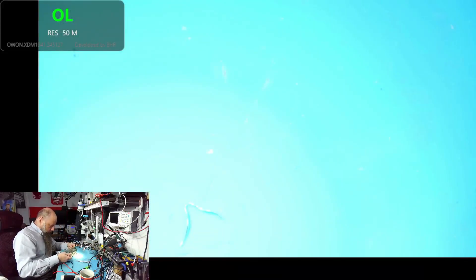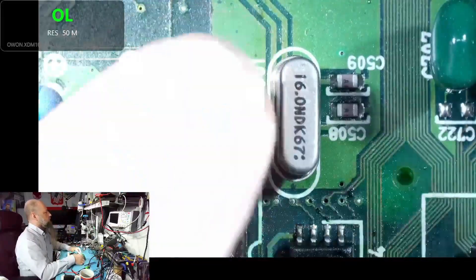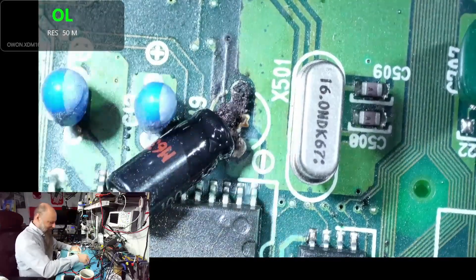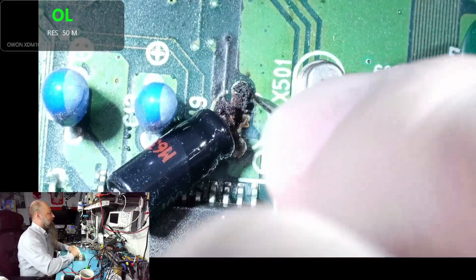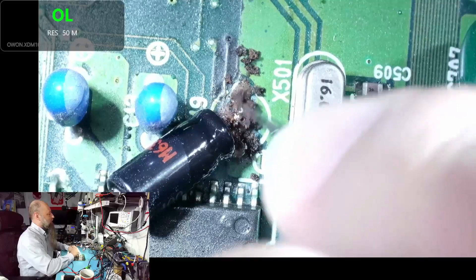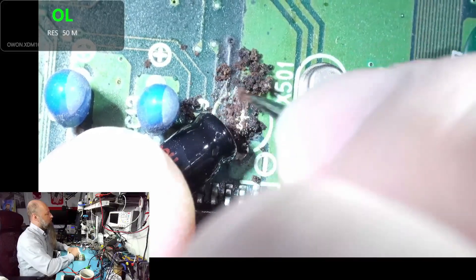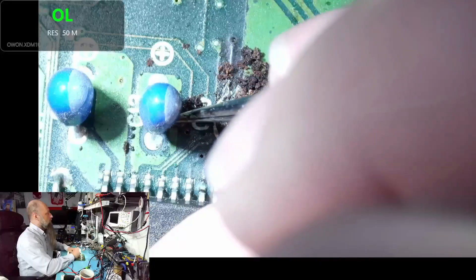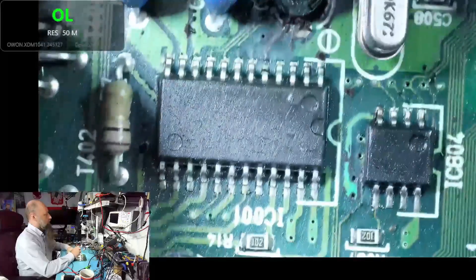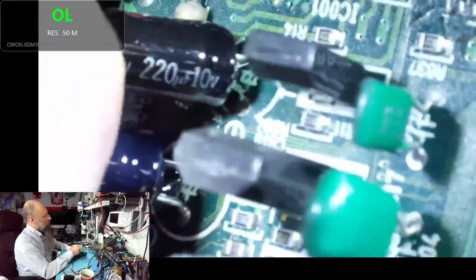There's likely no EPROM here — this is a 90s ECM, so no VIN lock, no immobilizer. Now look at this — there's your problem right there. It did leak, but actually I've seen so much worse. Interestingly it looks like all of the electrolyte just crossed over here and stayed in one spot, which prevented damage to the rest of the board. If you're going to have an issue, this is definitely the issue you want — no other damage.